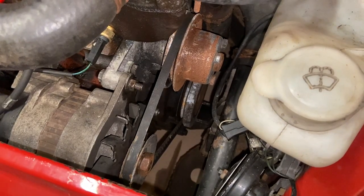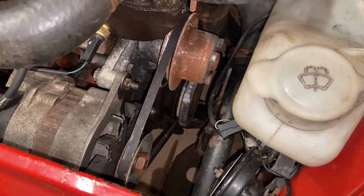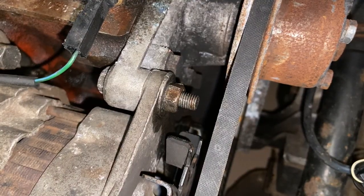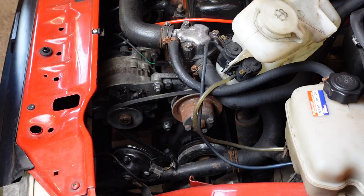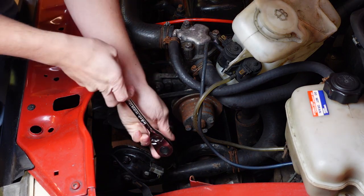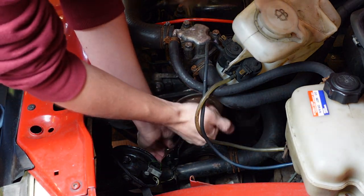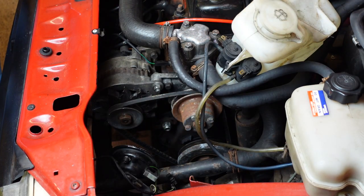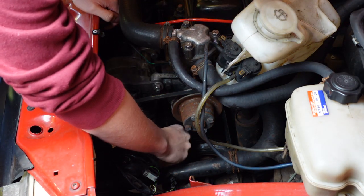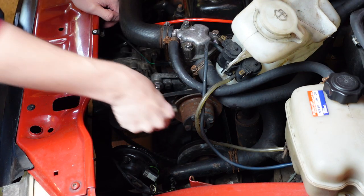To remove the belt, we need to remove all the belt tension, and that's set by the alternator mounting bolts. There are three of these overall — two along the top that take its weight, and another in a sliding bracket down below. First, we're to slacken and eventually remove the larger bolt to the side. This is where having a new car of a kind I haven't worked on before makes itself marvellously clear, as the A-Series engine is ancient and uses imperial hardware. As I live in the age of colour television, I have a very limited number of imperial tools.